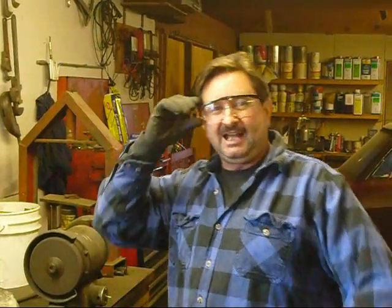Welcome back, glad you could join me. We've got our little Corvair motor all ready to prime up with the oil, and I wanted to show you guys how we do that. What we're working on is Desert Find No. 2 motor. I want to get oil flowing through it before I try to spin it over — it's been sitting for 25 years out in the desert. Once we get it primed up and get oil pressure into it, we're going to put the starter on a battery and crank it over and check the compression to see if it's a good motor and we can run it, or if we need to take it apart and fix it.